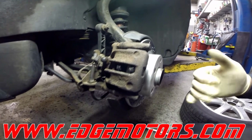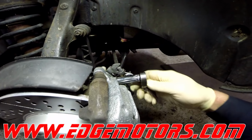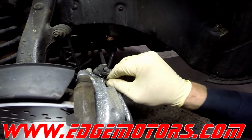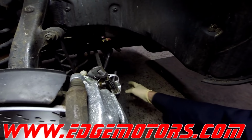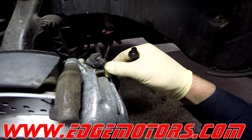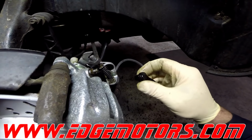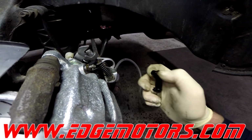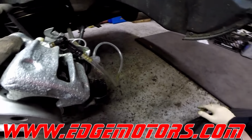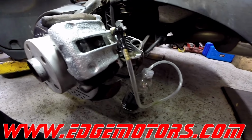That will be the rear left. So this is the rear left. Break the valve loose. Adjust it, so see it's closed, and just back off just a little bit so you could see the fluid coming out. See, it's got some air inside. Somebody didn't bleed it properly when they installed the new caliper. Now start pumping. Pump.